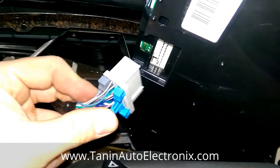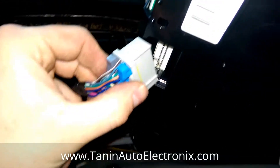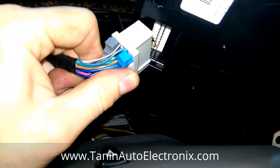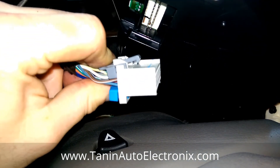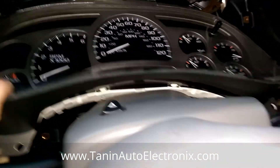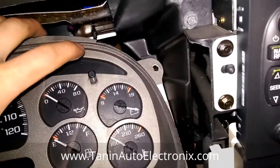So here's the removal of the plug. You'll see there's a tab on the top portion — this gray clip. Sometimes it's on here really tight, but you just want to pull down on this top clip, and then you'll have to wiggle or use a small screwdriver to pop it loose. It should come right out once you pull on this clip and then come straight out. Then you can pull the cluster out of the dashboard — it kind of goes in on an angle, so when you pull it out you'll have to turn it to get it out. Same putting it back in, just like that — plug it in and then line up the holes and screw it back in.